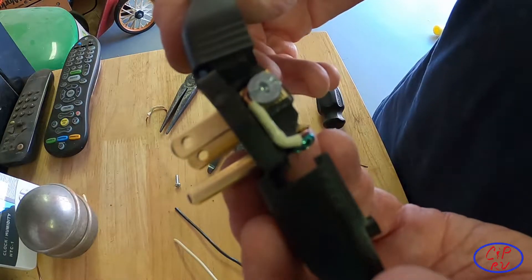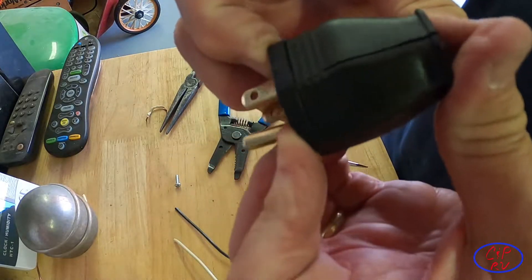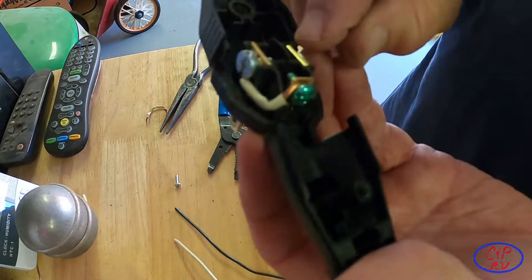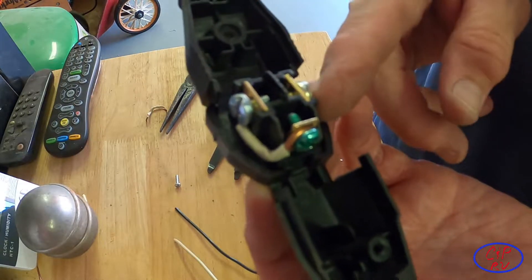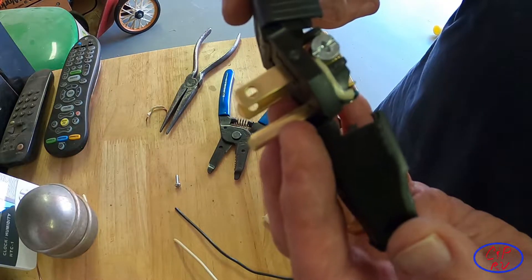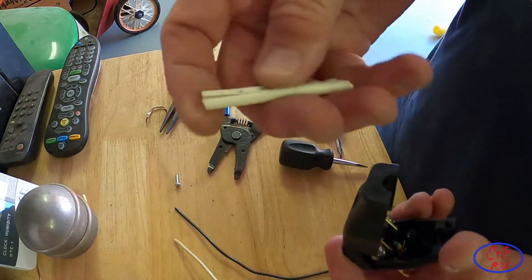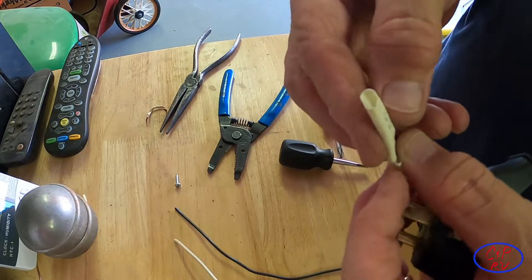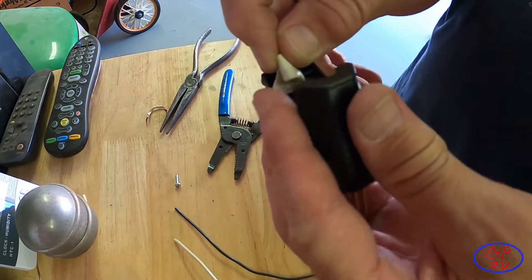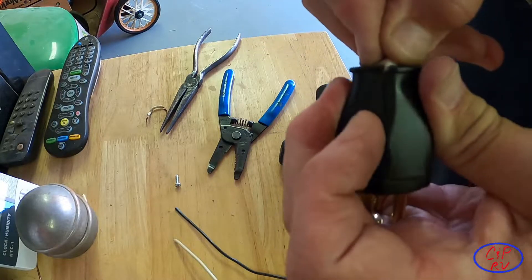I went back and redid this just to clean it up a little bit and make it a bit shorter because I was having a hard time getting the thing to close. Now I've got it nice and clean — it's nowhere near the hot side, we don't want it near the hot side at all. It runs right around here on this side and it's good and tight. Now I'm going to go ahead and button it up with a piece of covering from this Romex, kind of wrapped up in a small piece and stuffed down inside the corner here so that it closes up that back end hole.